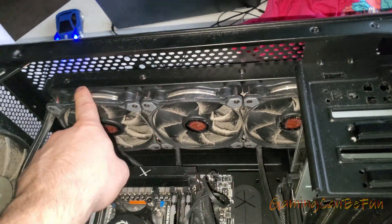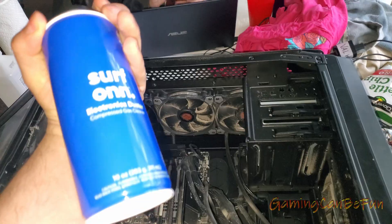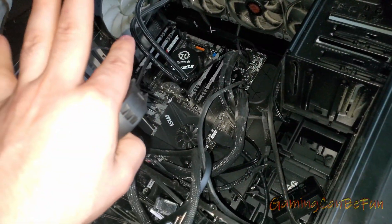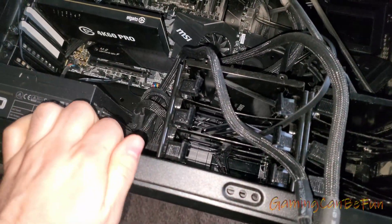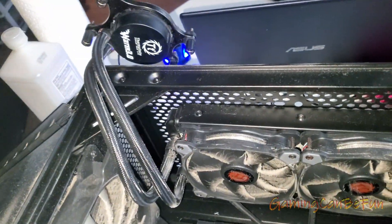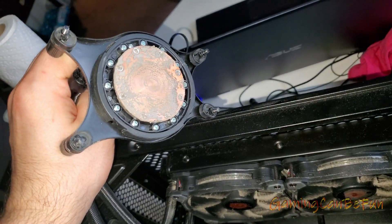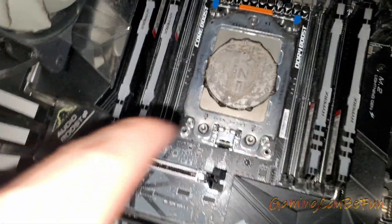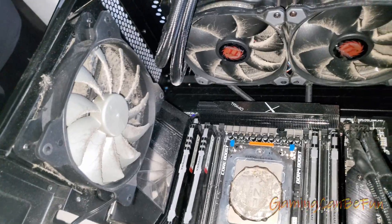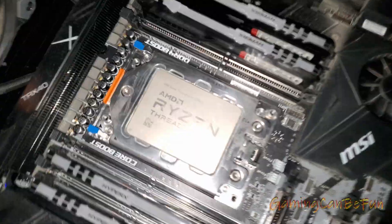You might want to unscrew the whole radiator, take the fans off, and use the air compressor to blow the dust out of those as well. Make sure everything is completely unplugged from the computer before you mess with anything on the inside. Also make sure you touch metal constantly to discharge any static electricity in your hands when operating inside a computer. I took the liquid CPU cooler bracket off and I need to wipe off the old thermal paste and reapply new, and I'm going to remove the radiator and fans and get rid of all the dust.